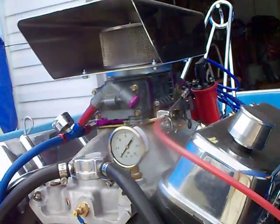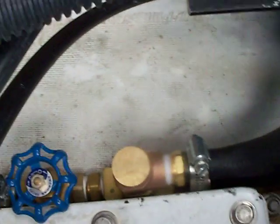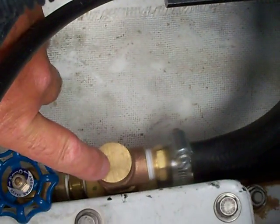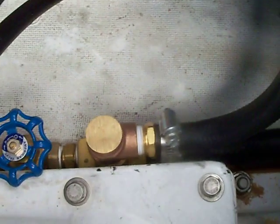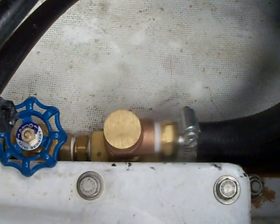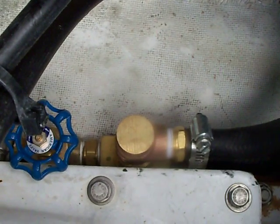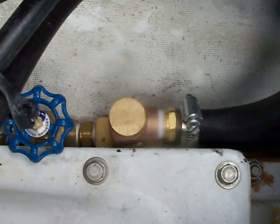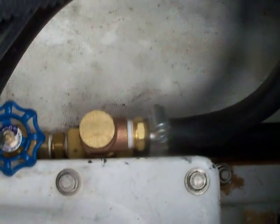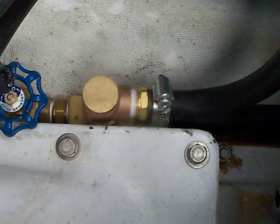If you have too much water pressure and need a way to relieve it, you can add one of these jet boat water pressure regulator kits. I have one on this boat — I don't need it because the water pressure never exceeds 10 pounds, but this is the kit. It has a relief valve here; if you take this cap off there's a screw inside you can adjust to raise or lower the relief pressure. By watching your gauge you can set it to maintain the pressures you want. With headers you have to restrict water going to the exhaust, which raises pressure, so you need a water pressure relief valve to handle that.